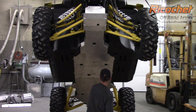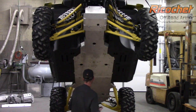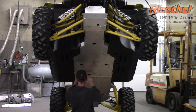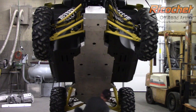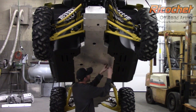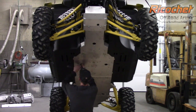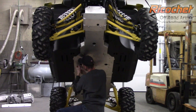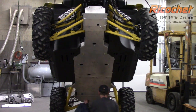All of our washers look like they're pretty well lined up. In fact, I tightened those first. It's usually best to tighten the cup washers just to make sure they seat correctly before you tighten the clamps. And we'll just move our way back and tighten the rest of the cup washers, and then the rest of the clamps. Again, it's best to hold the clamp until you get some tension on it. Once you have some tension on it, it will move on you. Make sure the clamp stays seated. Sometimes they can rotate, but usually not a problem. These two back here.